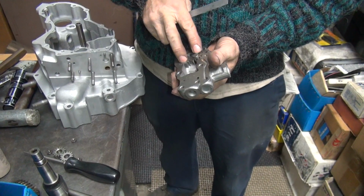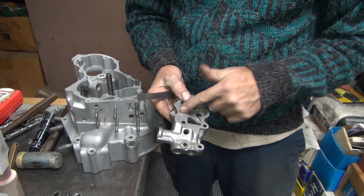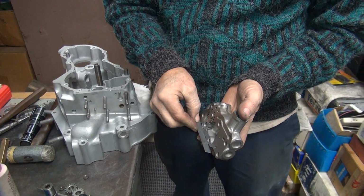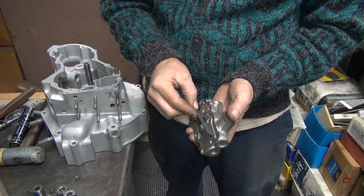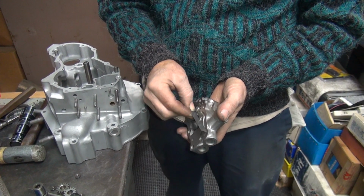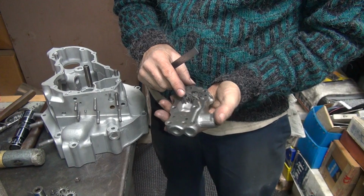The thinnest gasket we got here, we got to use. And over here we're probably good with a 9 or 10. But the pressure side, it's basically flush. See, it doesn't really catch the gears at all when you come across like this. So whatever the gasket is, that's our clearance. And 5 thou clearance is a lot of clearance.